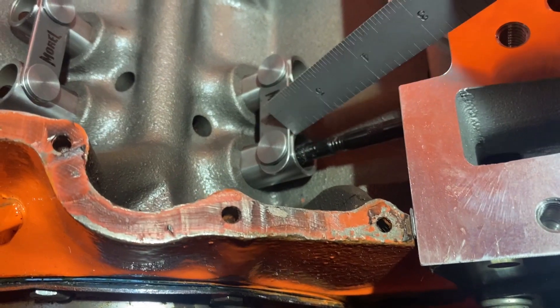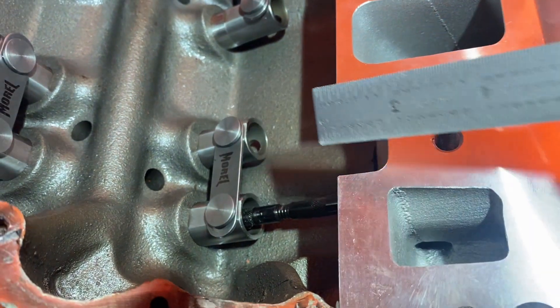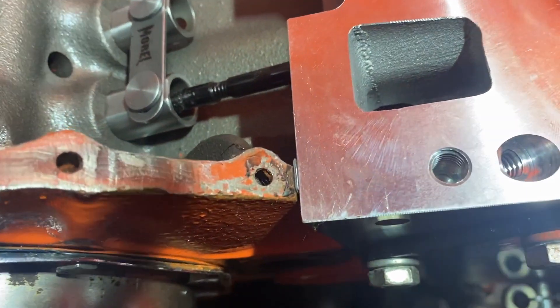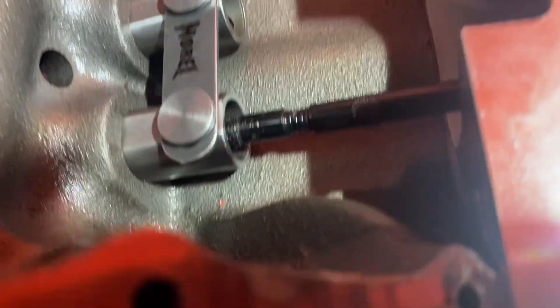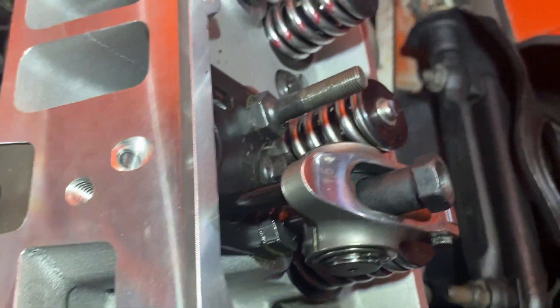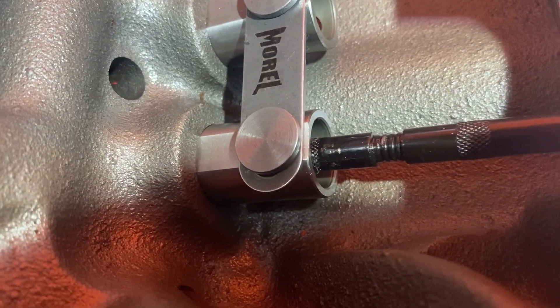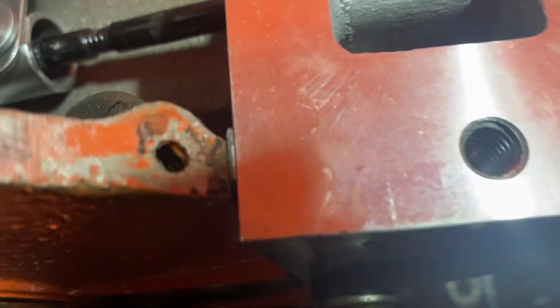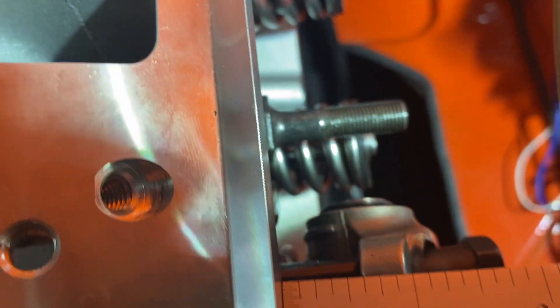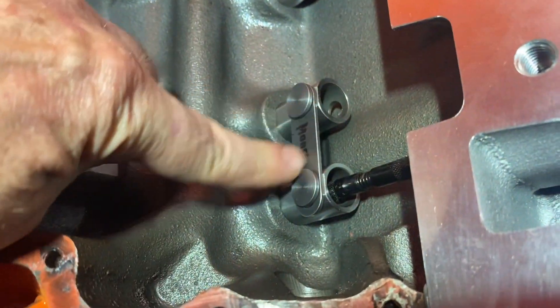My lifters — the hydraulic portion of it plunges an eighth of an inch, 0.125 inches. To verify that, because I'm going to do this with these fully plunged, I put a roller here at the top and it's three quarters of an inch. So I turn the nut and you can see it's plunging in until I can't turn it any more by hand. I re-verify the height and sure enough it's five-eighths of an inch. So I know that this plunger is fully plunged in.